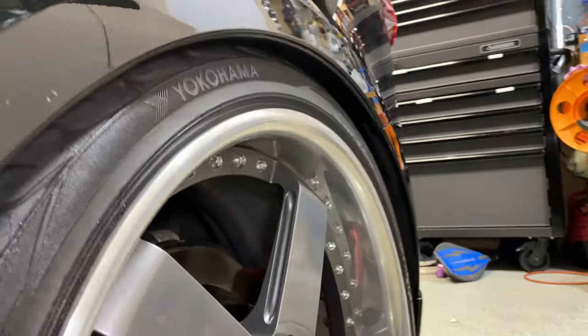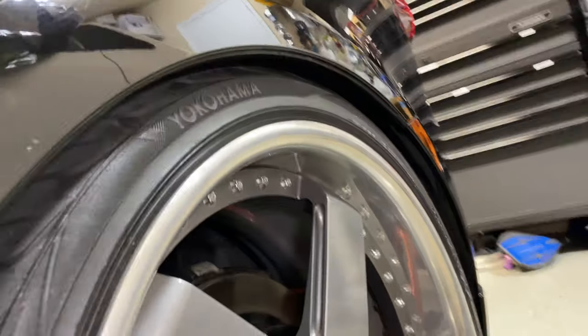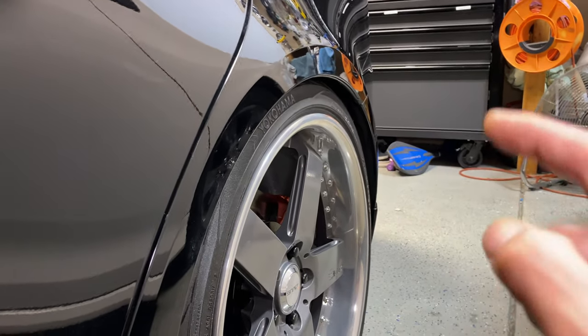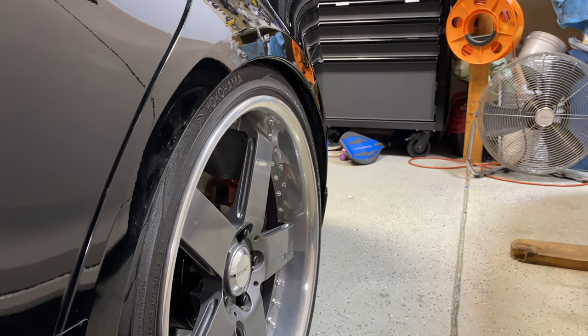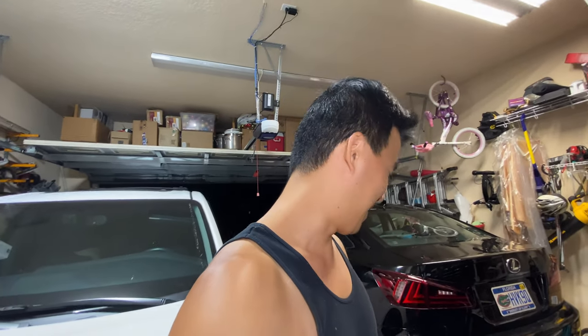On the back there's plenty of room. When I was on springs I was actually tucking a little more back here. When I got the coilovers I was able to dial it in so the front and back looked a lot more even. Anyway, hope you guys liked my video about fitting wheels on this car. It all comes down to the specs — you've got to know your specs, test fit the wheel, and if it came off another Lexus IS or even a GS, that's your best bet. The GS has basically the same suspension geometry, so if it fits a GS it'll probably fit an IS. Remember to like the video and subscribe to the channel!